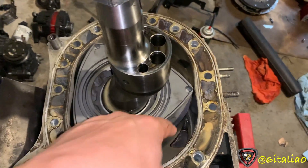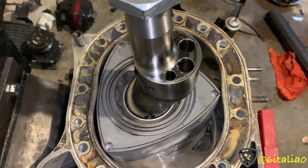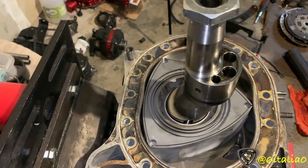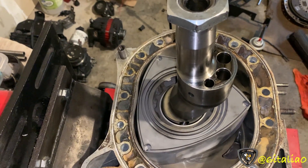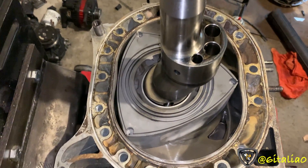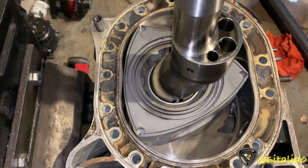What that means is at no point is the exhaust port open to the intake ports at any time. This cuts down significantly on emissions, which is why Mazda was allowed to keep it in production from 2003 to 2012 — except in the UK or Europe in general, where emissions standards got stricter.